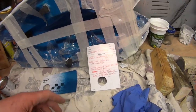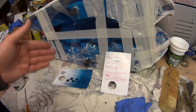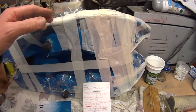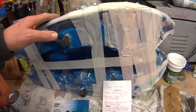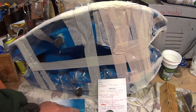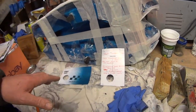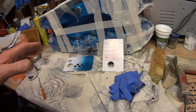There's an important thing to remember here. These flakes — although they're octagonal I think — they sit up in whatever you put them on. If you put that amount of flake on, you're not going to be able to sand it or flat it after you've put the clear coat, because the tips of them are silver. When you sand through one of the flakes you get a silver mark — I tried it, it looks horrible. So you've got to make sure you spray your clear coat perfect. You want perfect coats that you only need to polish, you don't need to rub down.